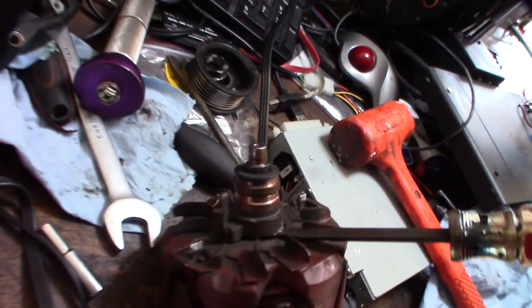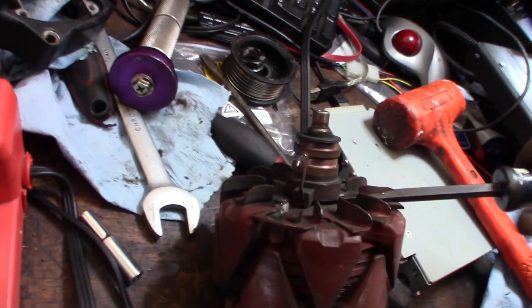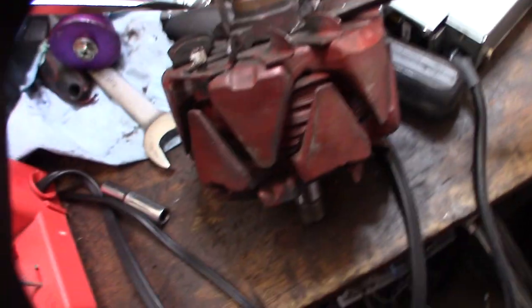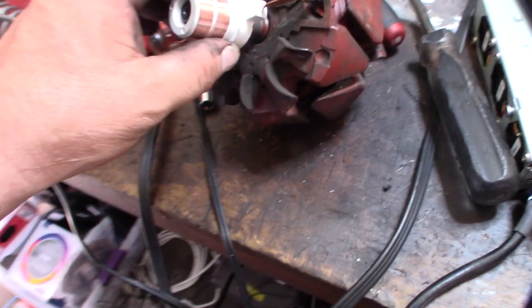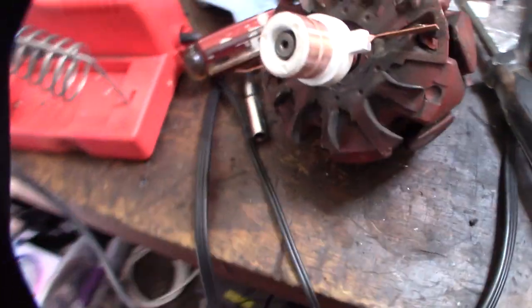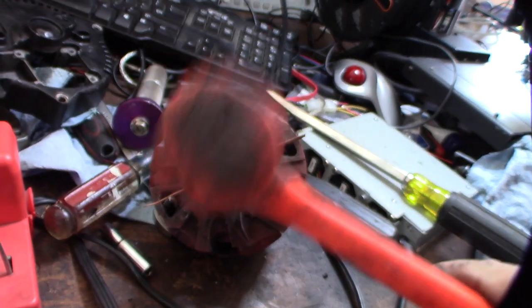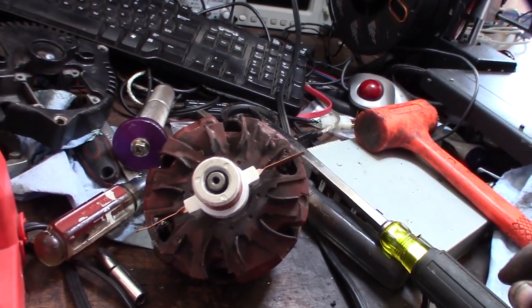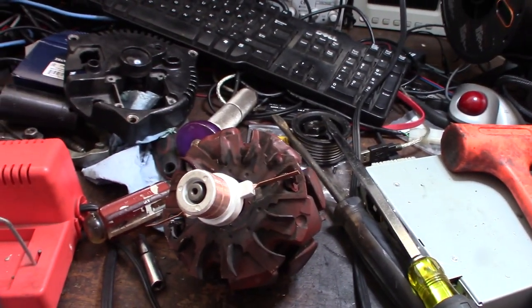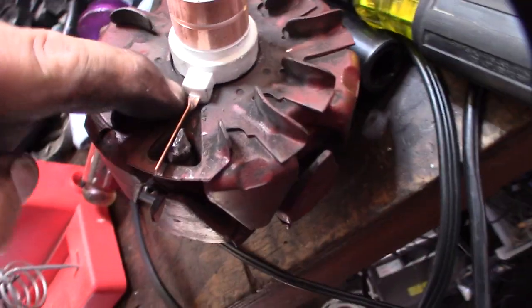The trick was to get the screwdriver under there. I'm going to keep going with a bigger and bigger screwdriver, and eventually just grab the two screwdrivers and push down on it. Look at that — there's the slip ring. This is the thing I'd be fragile with — I would be careful because it looks like it's pretty fragile. I don't know if it's made out of porcelain or plastic, but I'm going to be really gentle. You want to pound those in where those little notches go into that little area right there — that's what helps prevent it from spinning around on itself.